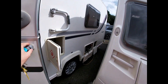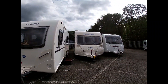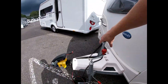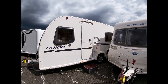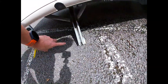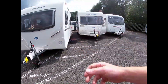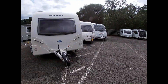When we get to our site, we need to be levelling our caravan — front to back and left to right. To level left to right, you may need some levelling wedges to raise one side higher than the other. Most pitches will be level left to right but not always. To level the van front to back, we use our jockey wheel — we can wind the caravan up or down using this handle. We use a spirit level inside the van or on the A-frame. Once level, we wind down our corner steadies, one on each corner. We do that once the caravan is level — we do not try to level the caravan with those because you can damage the bottom of the caravan and also bend the legs. So level it first and then put the steadies down, as they are there just to steady the caravan.